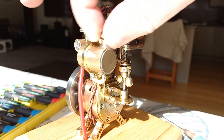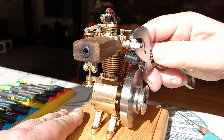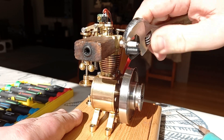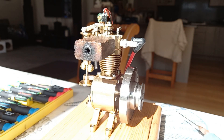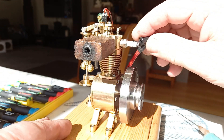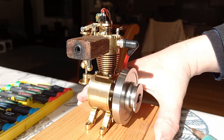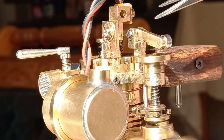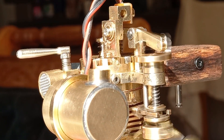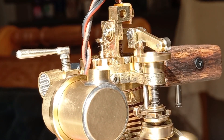So we're going to fill it up with petrol and clean the spark plug first, because it always likes to be cleaned before we run the engine. I couldn't believe that the spark plug was hiding down a little hole — it's very tempting to drill out that hole a bit, but one would hope that the makers of this engine knew what they were doing, so not going to do that. The engine's running really well at the moment, so better not tempt fate. This is no longer bouncing up and down crazily. You can clearly see the little bit of metal I've put on there to hold it up slightly more.